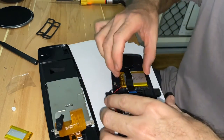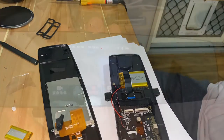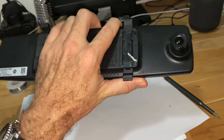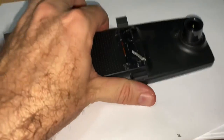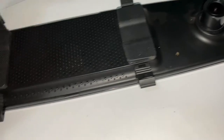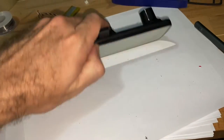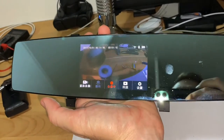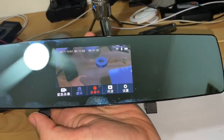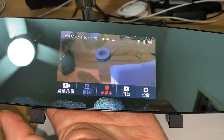I'm just going to try to neatly package it all together, stick a bit of glue or something under the battery and put it all back together. Now I've put it back together and it's running, no problems, saying full battery. It's not plugged in - usually it's in the car. I pulled off that sticker because I thought there might be screws under there, so I'll just put that back on, it's not very sticky anymore, I might have to put some new glue under there. It would usually die immediately when I turn off the key in the car - about maybe two seconds after turning the car key off it'd flash a red battery symbol, no battery, and turn off. So that's because that garbage little battery was dead. And now we've got a brand new 1000 milliampere battery.